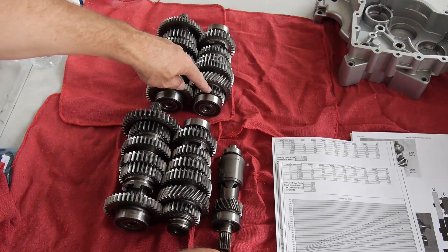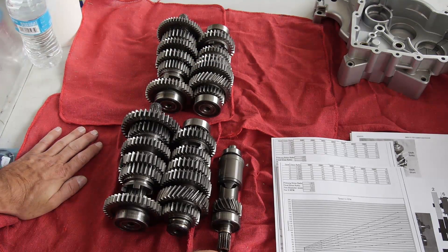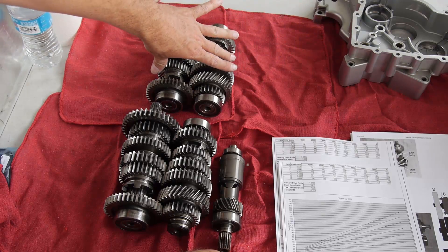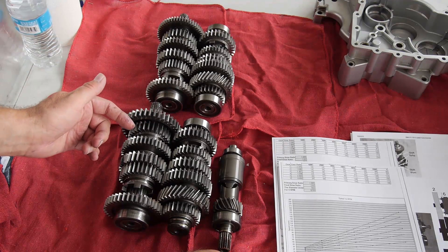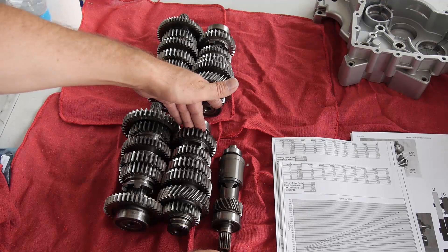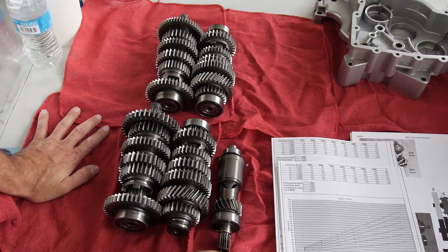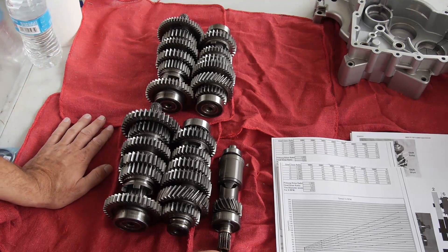At the same time I can press on the RS gear to replace the chipped one. The RS gears are all in fantastic shape. This cost a hundred dollars for the RS shaft, and the case repair also cost a hundred dollars, so that's two hundred dollars total — instead of the three hundred and thirty dollar input shaft from the last video. So I keep my low first gear, get a better overdrive sixth gear, have a repaired case, and the whole thing costs a hundred and thirty dollars less than expected.